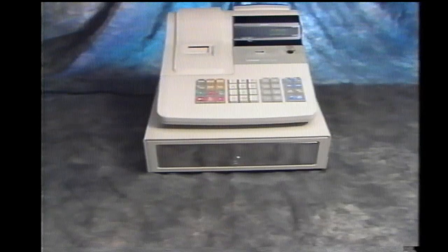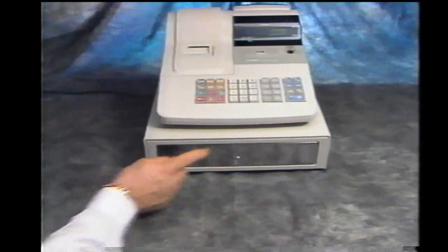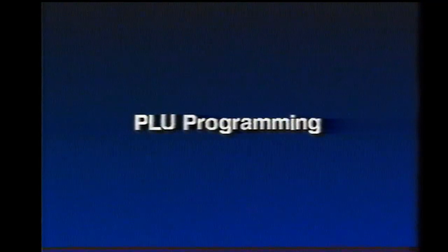Let's assume the customer wants 3 of these. Press the numeric key number 3. Press the X times key. Now press the department key number 3. The transaction is finalized. Note, if you ring another department key first, followed by the single item sale department, the drawer will not open because it is not a single item sale anymore. Use the cash amount tendered to finalize the transaction. Now close the drawer.